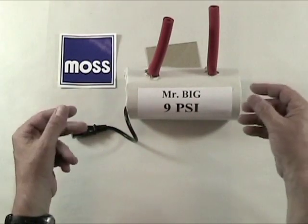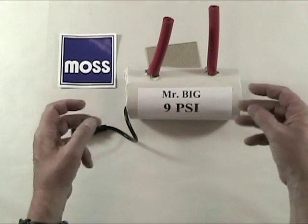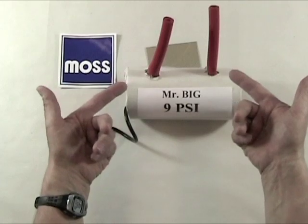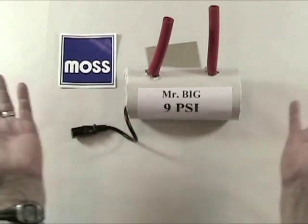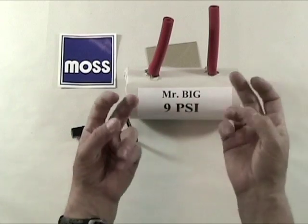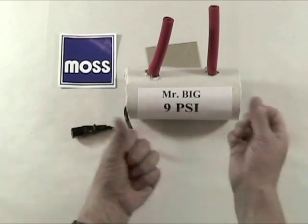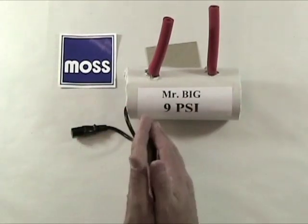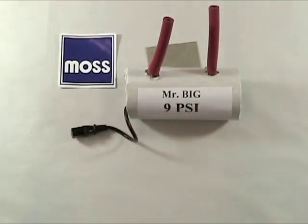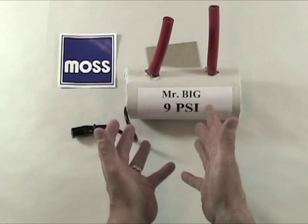The fuel lines in the British car often had threaded fittings on them, like brake lines, and they wouldn't connect to the hose barbs on a new pump. So, well, that's no problem. Guy got under there with a hacksaw, and in 2 minutes, the problematic ends on the lines were in the trash, and rubber hoses were fitted, clamps were on, and a moment later, the problem was just a memory. Now it's time for a test drive.